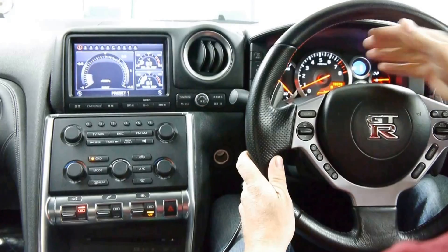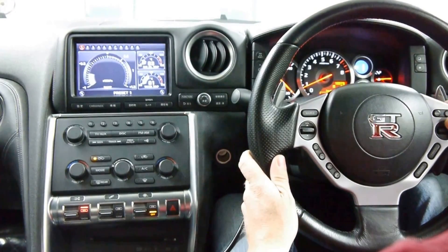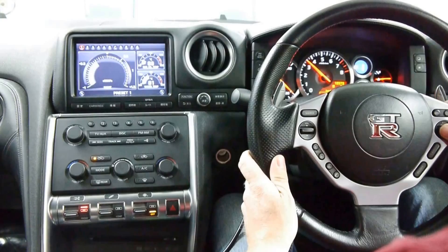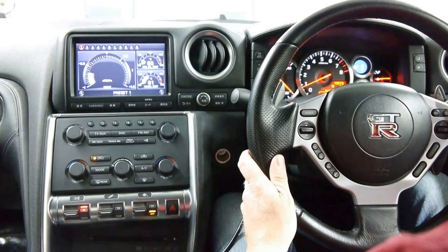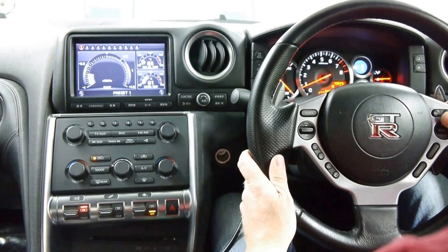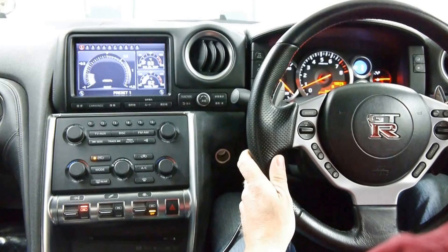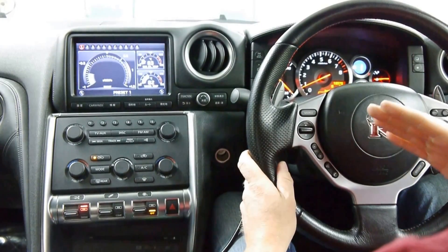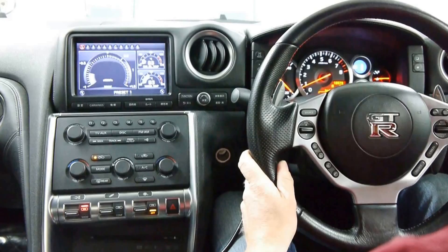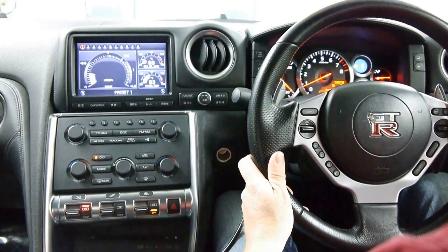For the purpose of the example I'm going to go back up to 4000 RPM. Foot on the brake, full throttle — up, up, up — 4100 RPM. So we can use the launch control adjustability to change the launch RPM depending on how much traction we have. If we get too much wheel spin, we can pull the revs down so we've got less RPM at launch. If we've got plenty of traction, we can take the RPM up.